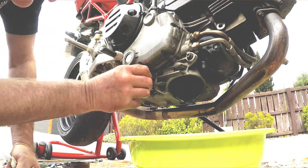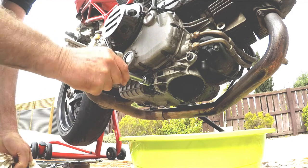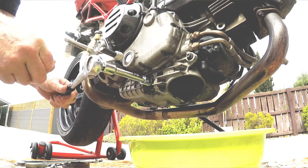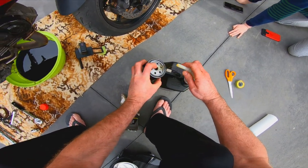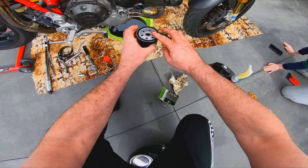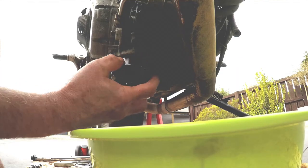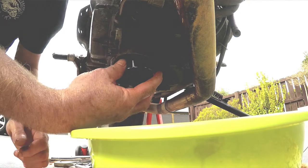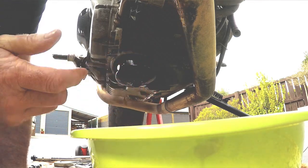Once you've got as much oil out as you can, it's time to put everything back on the bike: sump plug, filter, and of course your mesh filter. Like with any oil filter, you want to put a bit of oil around the rubber seal before you put it on. I've pre-primed my filter, which I recommend you do, so that as soon as you start up the motor, the oil pump isn't having to fill up the oil filter before it starts circulating — so it circulates pretty well immediately. Nip the filter up to hand tight — firm hand tight is enough for the filter.